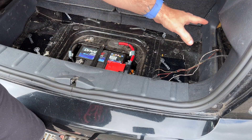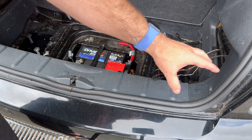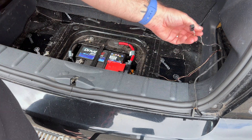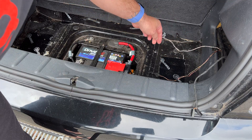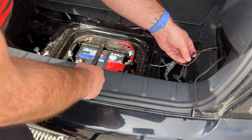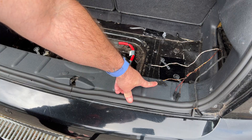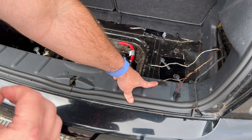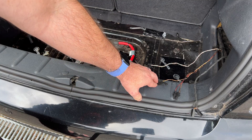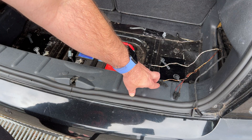In my boot there are options for a 6-disc CD changer, an amp, and a few other things including parking sensor wiring. I took apart this area and found various connectors - an always-live loop and what looks like a stereo connector. However, I found this badly set-up bundle of four wires which had the right colour combination for the KBUS wire. I put a meter on the end point and found that this KBUS wire when connected to ground was showing 5 volts, which meant there is a short to ground in that wire. It also explains why I've had a bit of battery discharge issues.